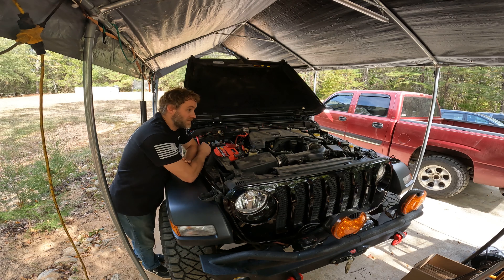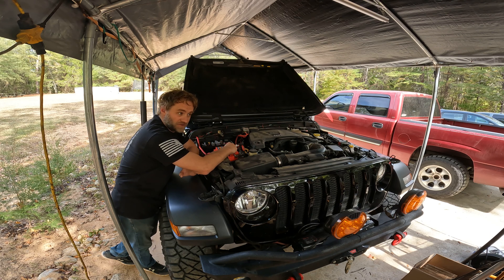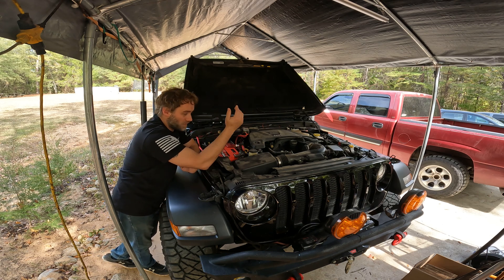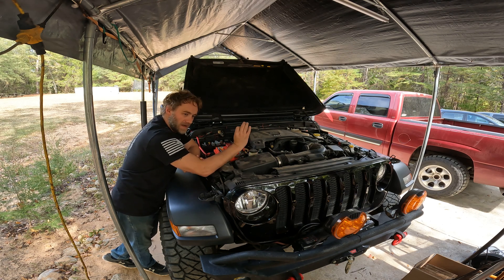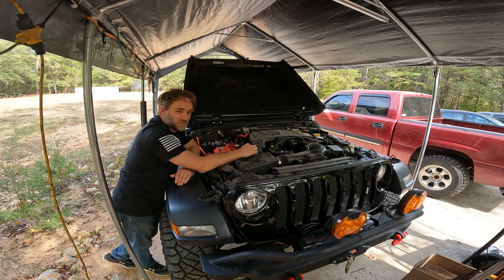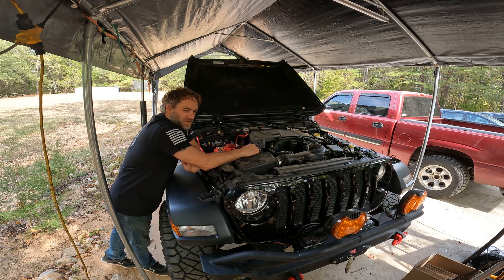All right, let's try another intro for the October update. I'm having trouble with the ESS function, the auto stop-start. What happened was a couple weeks ago during softball season, I'm just driving the Jeep back and forth to the ball fields. A light came on and it said 'Service Stop-Start System,' so I got the meter out and checked my voltage. My aux battery voltage was way low, down in the 11s; main battery voltage was in the 12s.